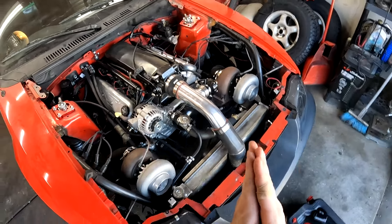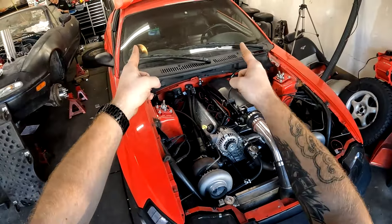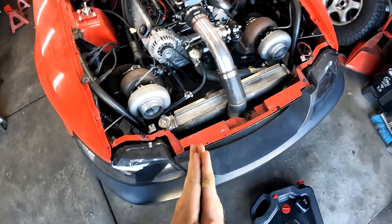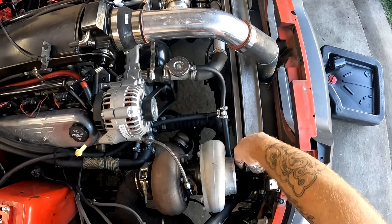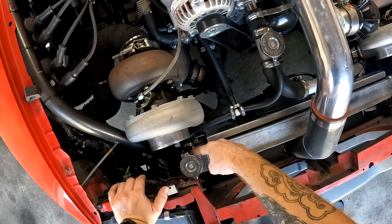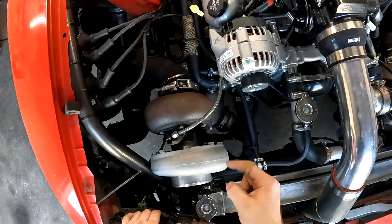It's been severely too long since I picked up the camera - 22 days to be exact. Since you guys last saw, we were putting the hood pins on. That's technically done - I'd actually have to make a bracket to make this side work to bolt it down. What I want to do is pull out the old Camaro radiator and cut this off and weld it off, because I think what's happening when it overheats is this section is actually pressurized, not for overflow.